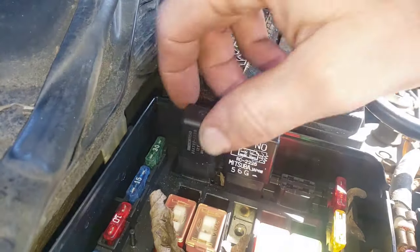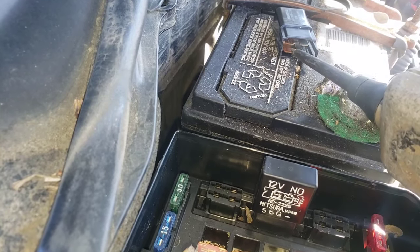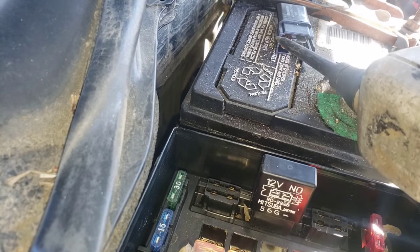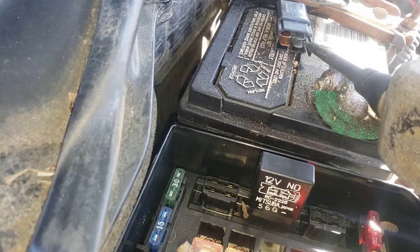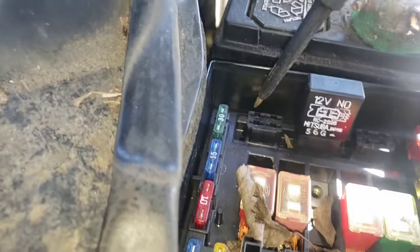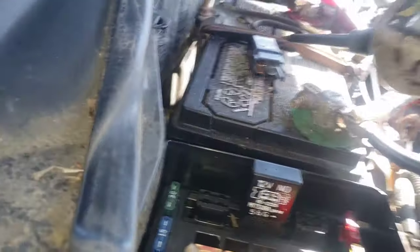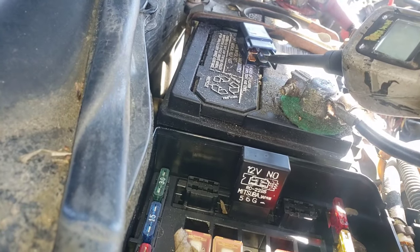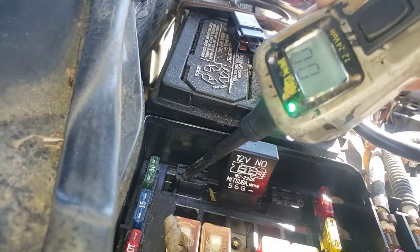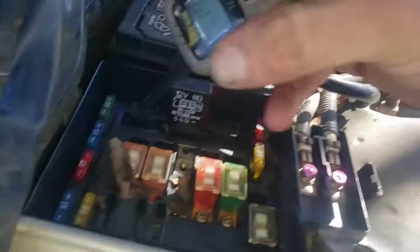The relay is sitting right here. I'm going to go ahead and take it out. The more orange — or metal-colored — one is your high-power side; that's where all your current is going to be. The other is the control side of the relay. We unplug the relay and look at the power side. We've got power there and negative there. When the relay is commanded on, it sends a small control current which magnetizes the relay, closes the circuit, and sends power through — and our fan cuts on and cuts off.